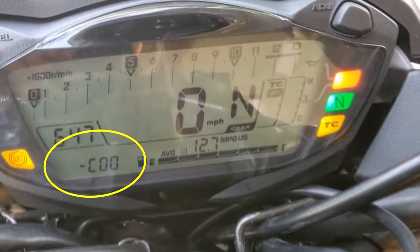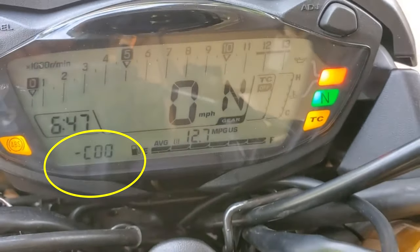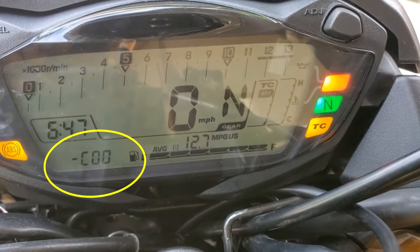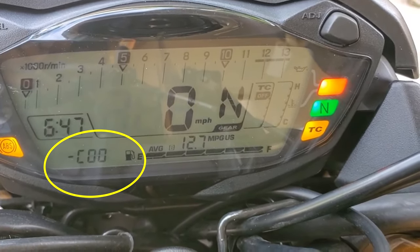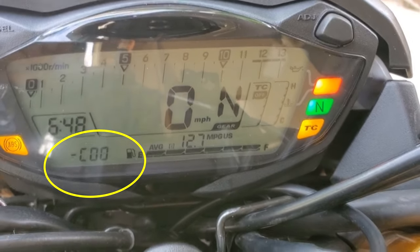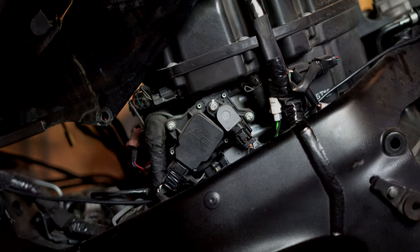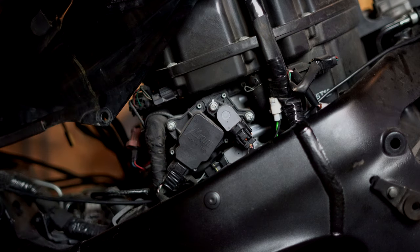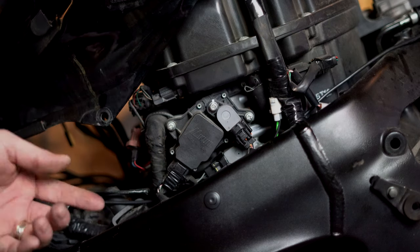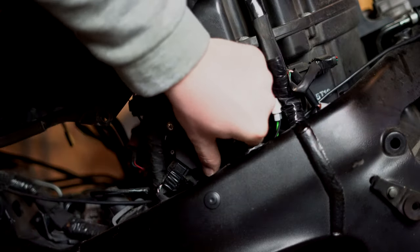At the bottom left of the dash you'll see a code that says C00, and to the left of the C you'll see a line either at the top, the middle, or the bottom of the C. Ideally you'll want that line directly in the middle — you don't want it at the top or the bottom. This is where you're going to need that Security T25 bit and you cannot move on without it. Go ahead and disconnect this black piece right here because the screw you have to get to is behind it — just push the button and pull it off. Pretty simple, just move that to the side.